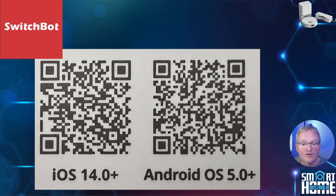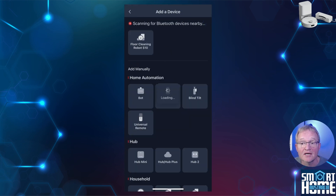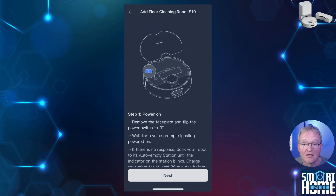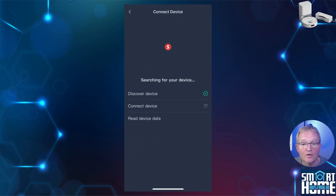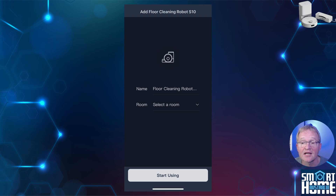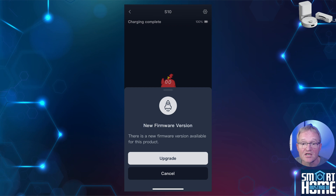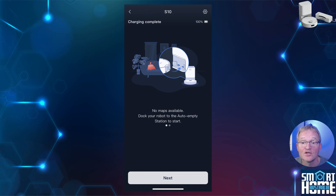If you don't have the SwitchBot app loaded, now is the time to download it — a QR code is on screen for iOS and Android versions. Set up an account and go to the home screen. Press the plus icon in the top right-hand corner. As the S10 has built-in Bluetooth it will be detected and show up ready to connect. Remove the top faceplate of the S10 and flip the switch to on, then press next in the app and select the floor cleaning robot S10. Press and hold the home button and the switch mode button for three seconds to enter pairing mode. Select your 2.4GHz network — note that 5GHz is not supported — enter your Wi-Fi password and press next. Enter a name for your S10, select the room it's located in, and press start using. The S10 and the watering station will check their firmware and advise you if an upgrade is required; as this is a new device with firmware under constant improvement, it's highly recommended to do both. Once completed, press finish and you're set to start the mapping process.